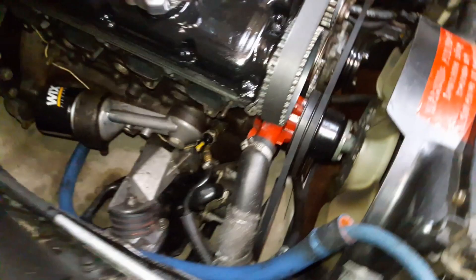What are these engine mounts right here — are those factory Volvo? Yes they are. Are they standard automatic Volvo? No, but they are for standard Volvo 740 or 940 series turbo, and they are specifically braced differently. I'm using a Jaguar XJ knockoff engine mount and also using the bottom brackets that go with these type engine mounts, because the tops are different, the bottoms are different, and both sides are different. So you have to get the whole kit — the bottoms and tops, both sides — in order to run the stronger brackets, and it makes a huge difference. Don't think it does? The whole car shakes; the motor doesn't.